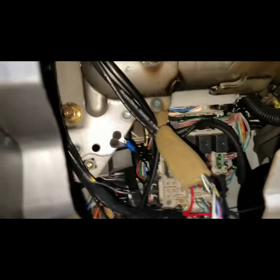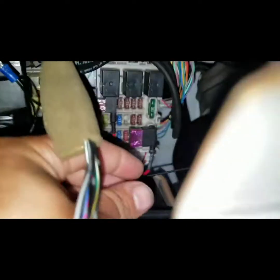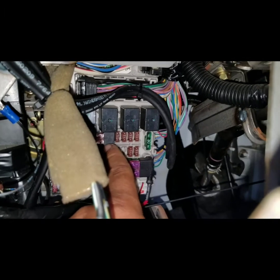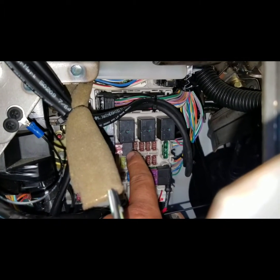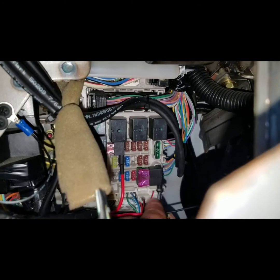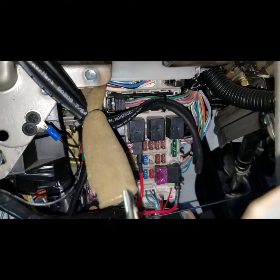For the ground, I've tapped into any metal. You will need these fuse tap pieces — one is the accessory signal, it's the second one from the left. And then you're going to need a bigger one that's going to be your 12-volt constant, so it's always hot. That's where you tap in the gauges, and then you should be all good.